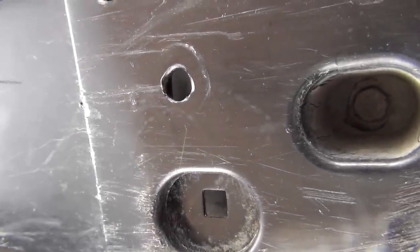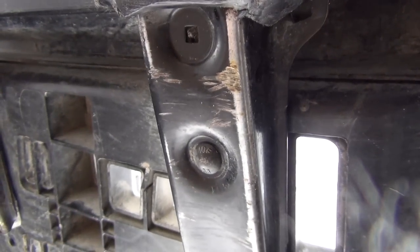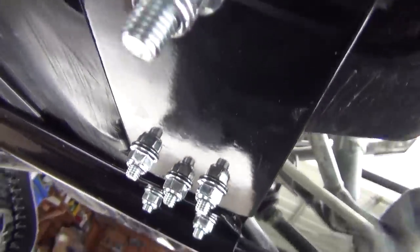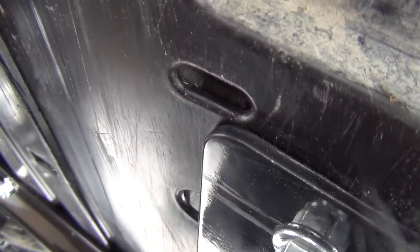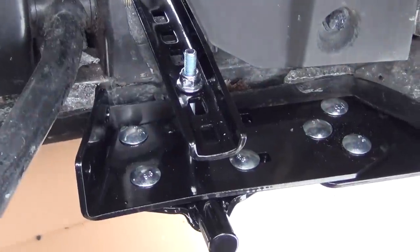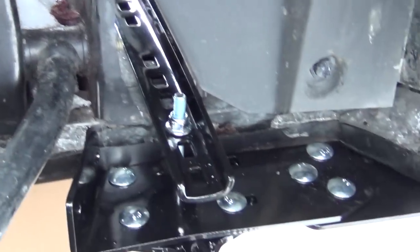There's that hole I had to drill - that's on the left hand side of the four-wheeler. That's the floorboard support right there. The hole in the plastic I had to elongate a bit just so that these plates would sit straight, but it's pretty tight under here. That's basically how it looks. That one plate goes across there and then bolts come up there, so if you ever did want to take it off in the summer there'd be just four bolts - that one over there, one on the other side, and two at the back.